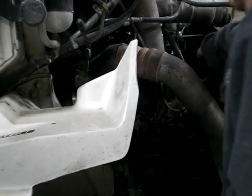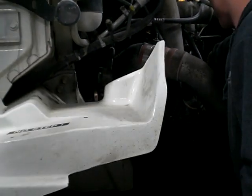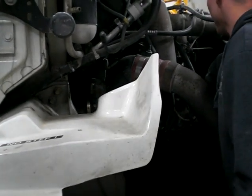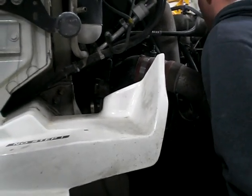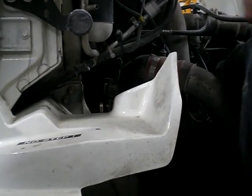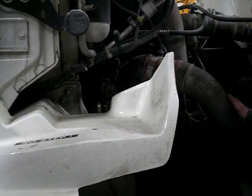I'm gonna start looking at my belts. They're properly mounted, secured, not cracked, bent, or broken, have no missing or loose hardware, and no frays or cuts, and there should be 3/4 inches of give per 1 foot of span. And it seems to give that because this is a span that is about 1 foot.